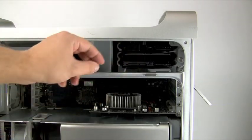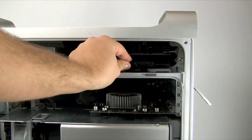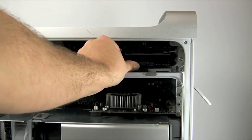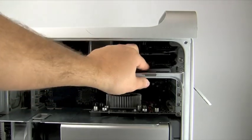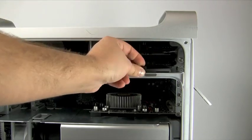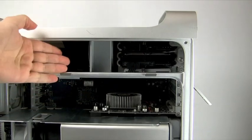There are no additional cables necessary as Apple provides them for you. Pull outward on each of the two cables to loosen them from their stored position underneath the drive tray. You do not need to pull them out very far, just enough to connect the data cable and the power cable to the back of the drive. The connections only fit one way, so don't worry about plugging the cables in the wrong direction.